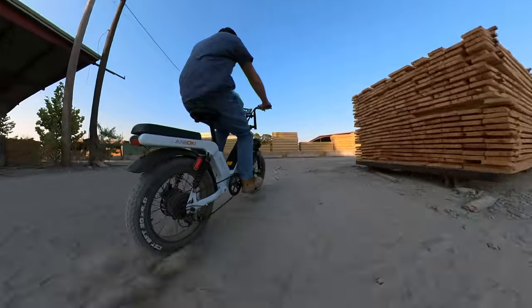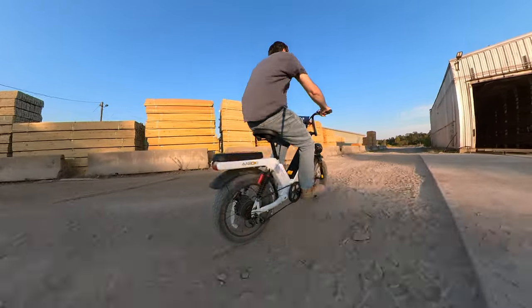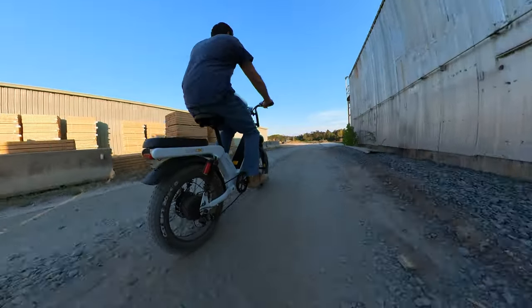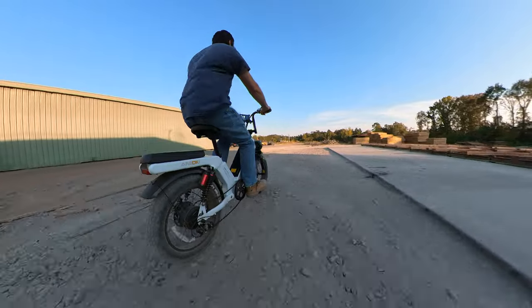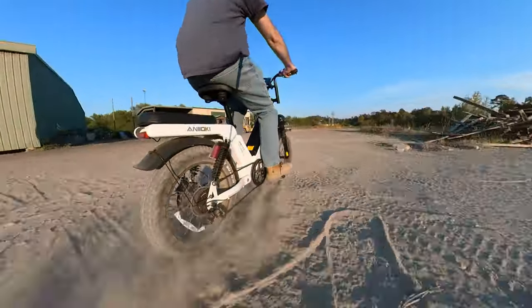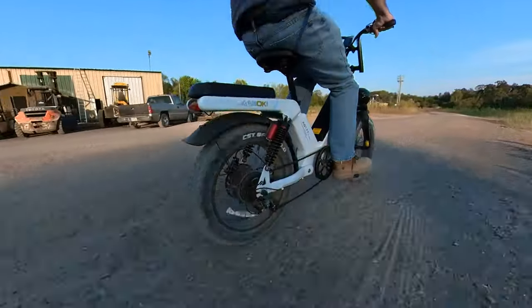This particular bike has a healthy mix of both positive and negative features, so I'll just mix them together. The particular model I've been testing for the past 4 weeks has the 48-volt power system with a 60-amp-hour battery. For a bit of context, a 20-amp-hour battery is on the upper size of what I look for in an electric bike, and this is 3 times larger than that.